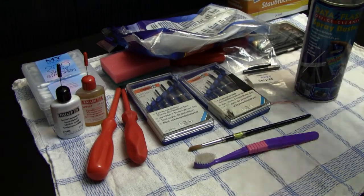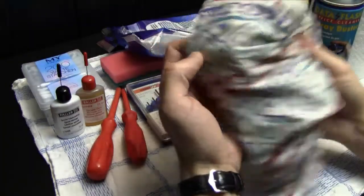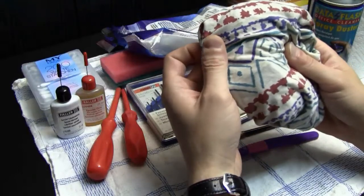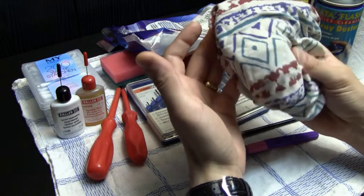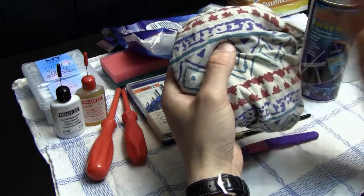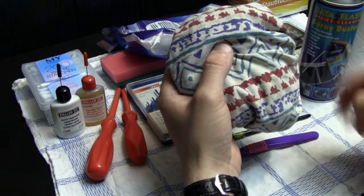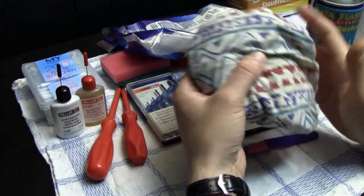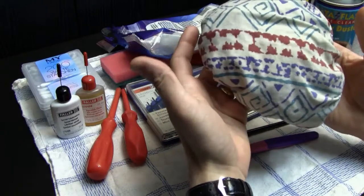Then besides the paper towels, I also have always at my side somewhere basically a cloth. This is an old t-shirt, a very old t-shirt, and I use those when you have to clean something, like for instance a cartridge slot, because you wanna clean all the contacts in a cartridge slot. If you would use just a paper towel, this would completely rip apart in the cartridge slot and would actually leave also the bits of the paper towel inside. So you need something stronger.